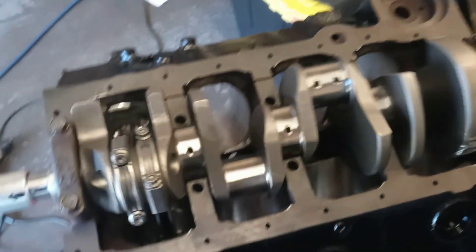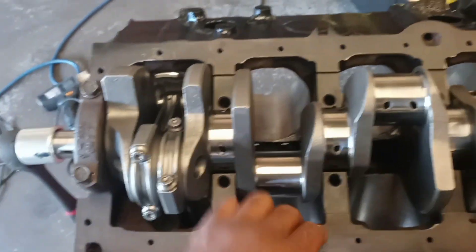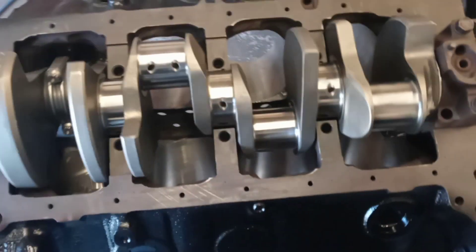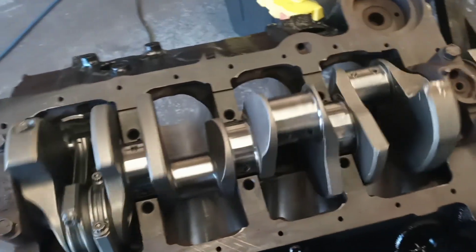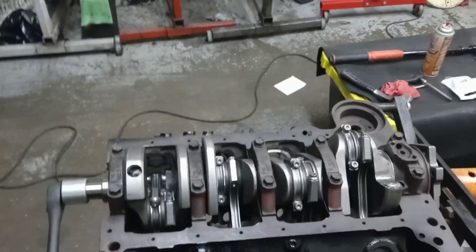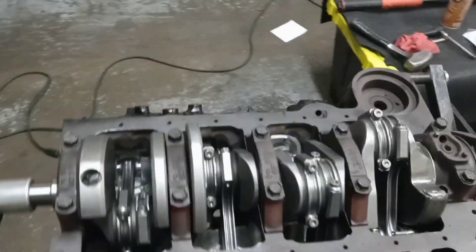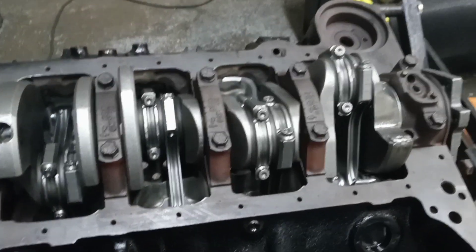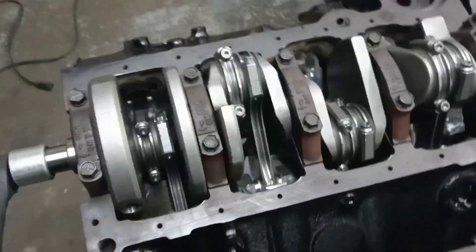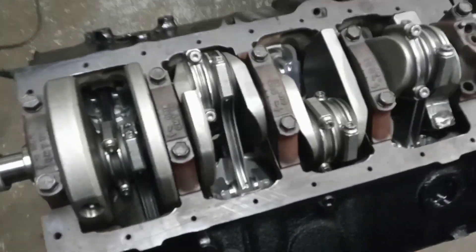Every cylinder — once I've assembled the whole engine — should spin and turn just like this. We're going to take these two back out and move to the next cylinders: three and four, five, six, seven, eight. We're going to check each cylinder, rotate it, and make sure each cylinder has proper clearance before we finalize the assembly. Bottom end is complete — everything is torqued: the crank, all the rods — and you can see right there from where they balanced the motor. Once everything is in, it should spin over freely, no binding, no hard spots, no kinks.